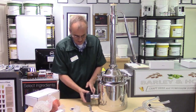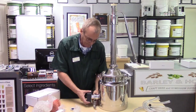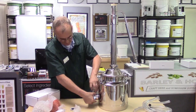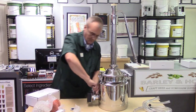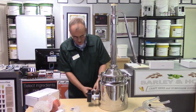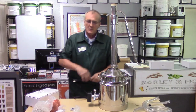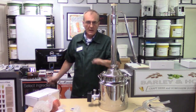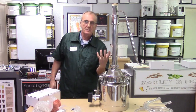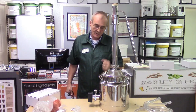Install the heating element with the gasket, using the same clamp used to remove the port plate. That holds the heating element securely in place. You now have a 120-volt, 2,000-watt heating element inside the pot. Don't use anything less than 1,500 watts — below that, it will take too long and you may never reach the proper temperature.